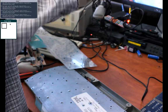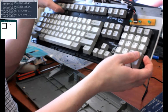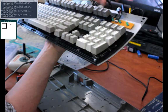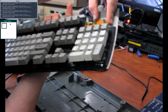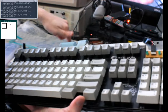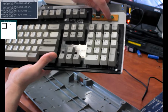Another thing I want to say real fast, these early model boards have additional keypads, like under the numpad here, there's an extra spot on the membrane right here that you can put another key in, and it will send scan codes to the computer. Even later Model Ms, like my 1993 Model M controller board, will send those codes if there's something hooked up there. I don't know if all the later membranes have that pad, but the Unicomp one does. So it should be an exact replacement, except that this doesn't have the ribbon cable membrane because it predates that. And this was retrofitted on.